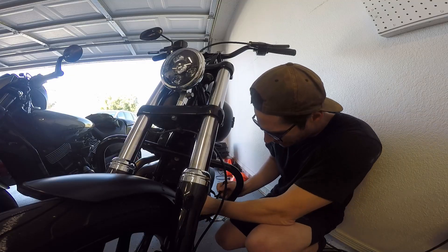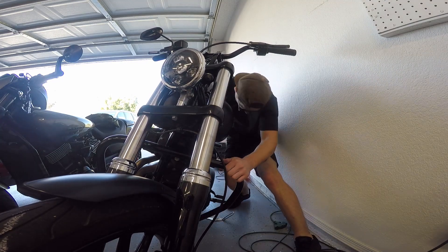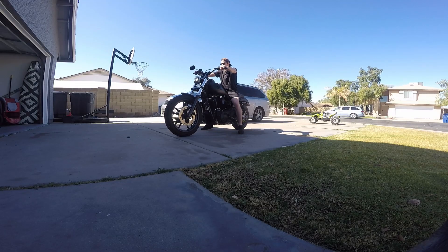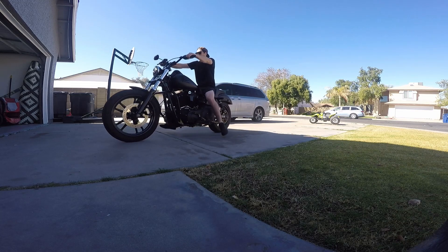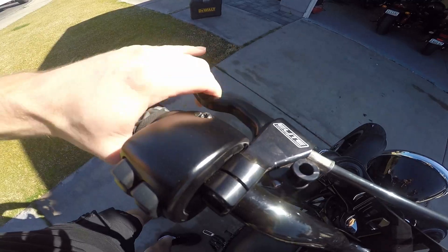And if it is feasible then we will have Jackie try out the Dyna. I got the clutch adjusted so it's a lot easier. The reason I don't have it adjusted like this for my riding is because I need space when I do wheelie clutch-ups — I only use one finger and I need space for my other fingers. But adjusted like this, Jackie can easily grab it with her entire hand and it's not too stiff anymore, so she might actually be able to pull this off.